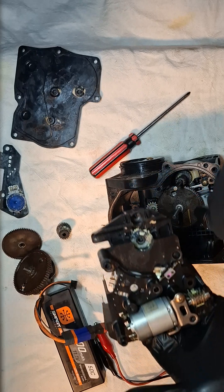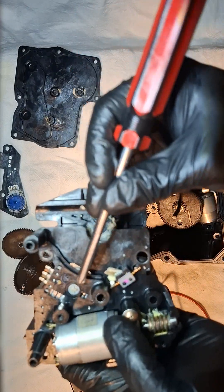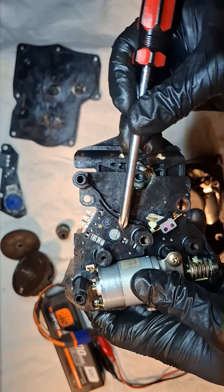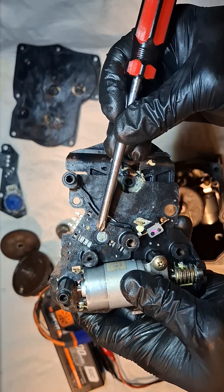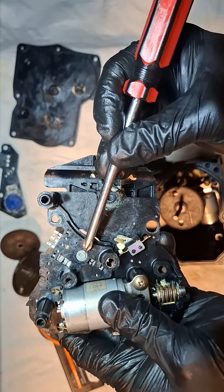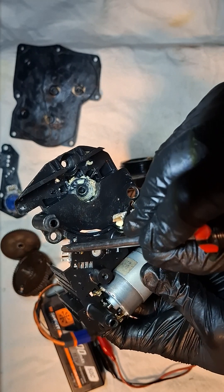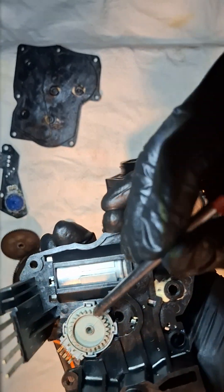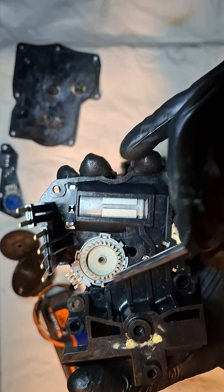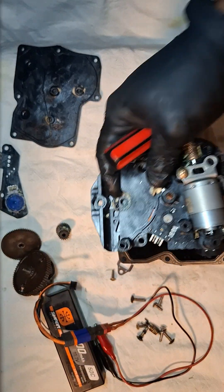This is the signal from this motor — it tells your ECU if it's engaged or not. The problem is the motor just keeps spinning with no start or end point. To set it back, I have marked it. You can see this line goes directly into the middle one — it comes in a straight line. From the bottom you would see this line comes across the middle of the clip. One, two, three, four — this is the middle one. Now this is set to the zero point, straight, and then we can fit it.